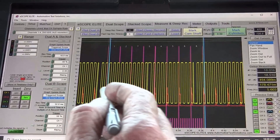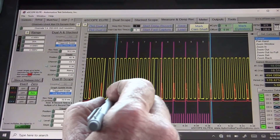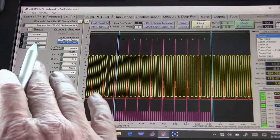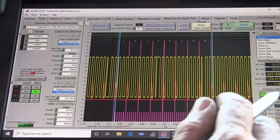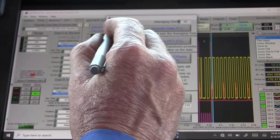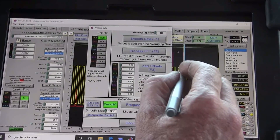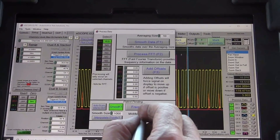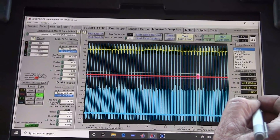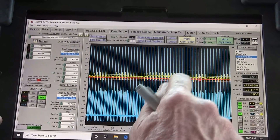The next one is I want to go ahead and look at the cam signal. When we're looking through the cam signal we want to make sure that it's clean and there's no lines that come up or down that the computer could count to get it out of sync — there's no noise on it. So this signal right now is good and the car is running good. The next thing I want to do is process the signal. We want to shut off all of these and just keep channel one, and what we're going to do is turn this frequency plot and turn it into the crankshaft velocity changes.